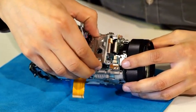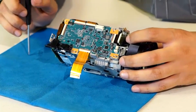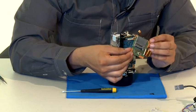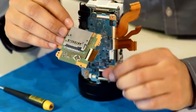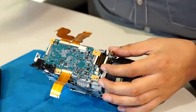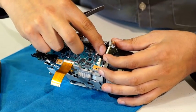This also helps tell you how much battery you have left through the screen. With all of that detached, we can now see the main circuit board, and here is the board that reads the memory stick and/or SD card with the slot attached to it. This small metal circle on the board is the camera's backup battery, should the main battery be compromised. Next is the removal of the infrared board and another flexible cable which sends info to and from the main circuit board to different parts of the camera.